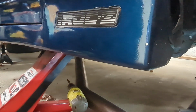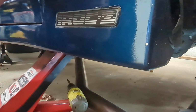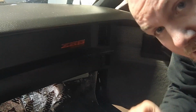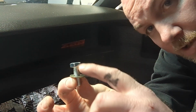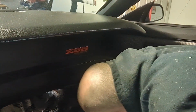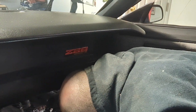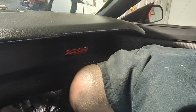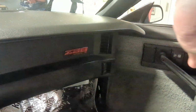I'm going to put in 2 bolts now. The bolts are going to go in through the floor. They're going to have a washer on either side. Alright, so it's a pretty tight fit in here. Again, I got my bolts. I'm going to put a washer on the bolt side and on the nut side, and push it right through the floor where the hole I made. There's one. And the other one's going to be a little tough because I drilled right through the Kill Mat.